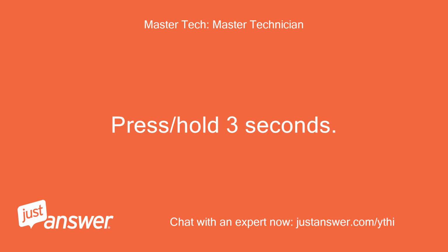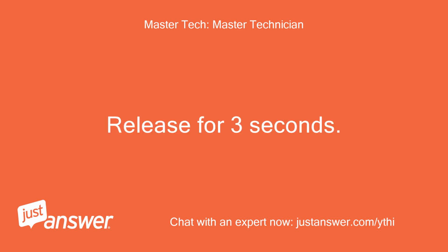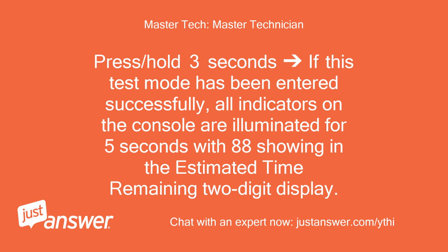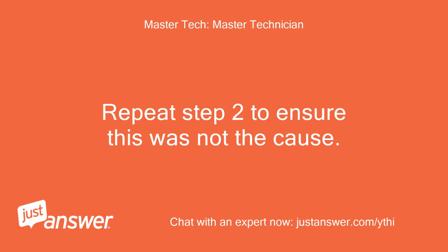D. Release for 3 seconds. E. Press/hold 3 seconds. If this test mode has been entered successfully, all indicators on the console are illuminated for 5 seconds with 88 showing in the estimated time remaining 2-digit display. If indicators do not display as described above, the press/hold/release procedure above may not have been performed within the time frame necessary for successful entry. Repeat step 2 to ensure this was not the cause.